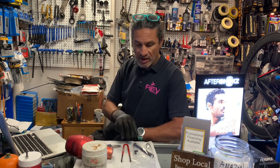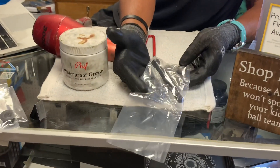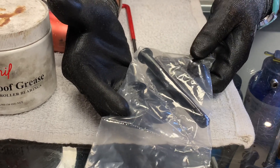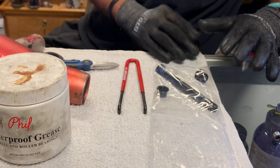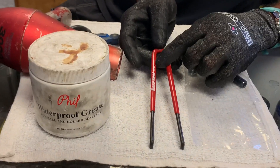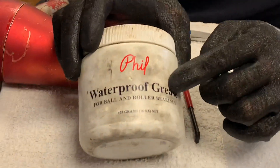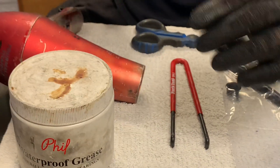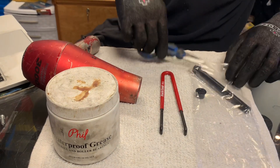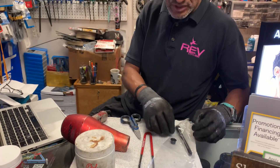So let's get started on the topic of today. What I have here is a through axle conversion kit — I'll link where I got this in the description. You'll need the through axle kit, a Spanner-2 from Park Tool, some scissors to get the packaging open, and a little bit of grease. You'll also want to heat it up, as there's some thread lock material already applied.